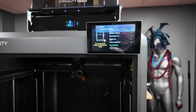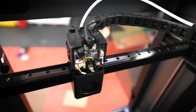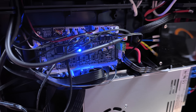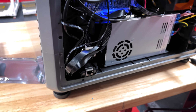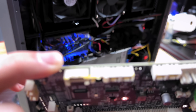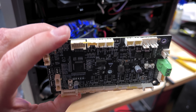They then sent over a printhead PCB replacement board to replace — that didn't fix it either. And most recently, they sent over a motherboard for me to swap out, and went through that entire process of swapping out every single cable that goes into the motherboard on the very back of the machine. That still did not resolve the print issues.